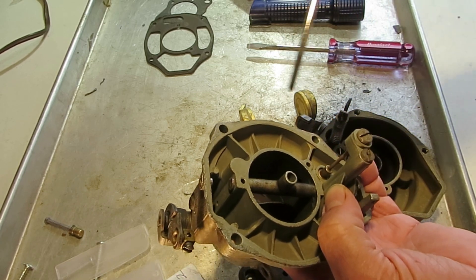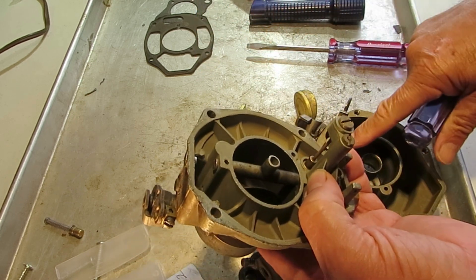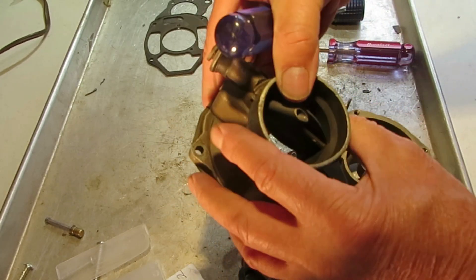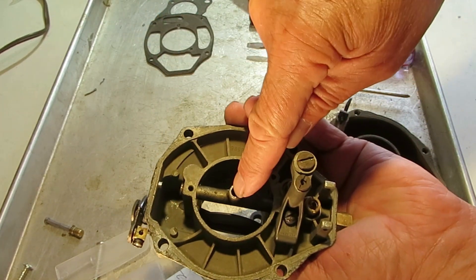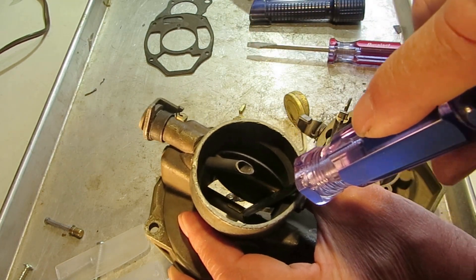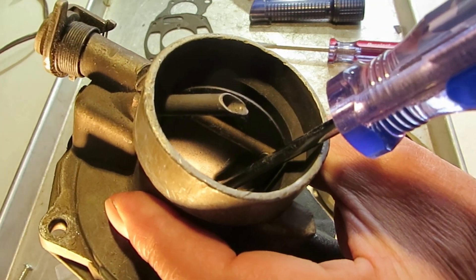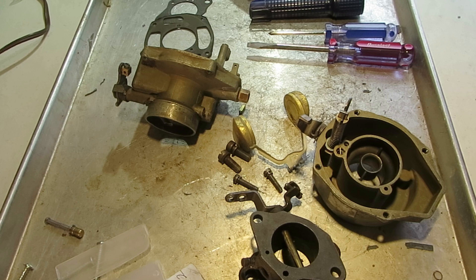Make sure those are clean and you can blow through them. So if you're having a little trouble with the off-idle, check that circuit I just showed you — make sure they're clear. Blow air through each piece and make sure there's air coming through. You'll find a lot of times that circuit will be plugged up. That little hole right there is the idle discharge, and I just wanted to explain that. A lot of people aren't aware of it. Thank you for watching.